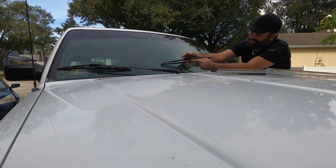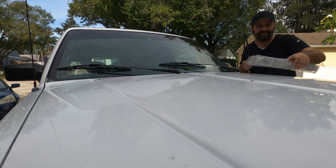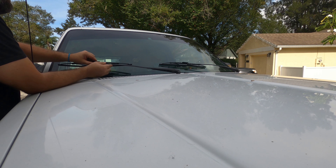Also, read the instructions — it helps. I've gotten this one wrong a couple of times, and if you don't get the activator just right, it will either immediately fall off or fall off within a couple of days. Apply the activator to both the windshield and the button — I think that's what I've done wrong every time; I've only put it on one surface. Maybe it'll stay up there for a couple of years this time, we'll see. The directions say to allow the activator to dry for five minutes, so I'll come back and put the adhesive on.